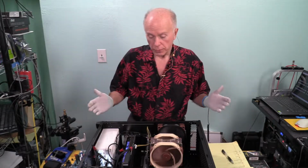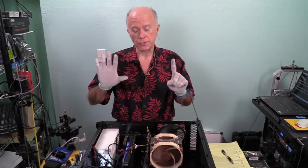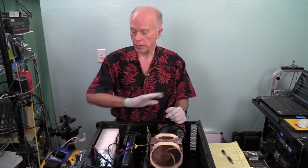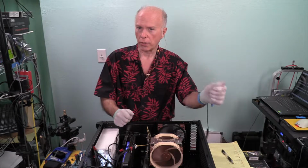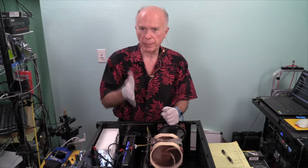And then that will help to establish if there's any difference in this format of 6 drives of an 8-lane slot versus a 16-lane slot running at PCI Express 3, no matter what the drives are. Because no matter what the drives are, the PLX chip, that's your governor that's controlling the speed. It's no longer the chipset on the motherboard. It's no longer the speed or the spec of the drives, that PLX chip.